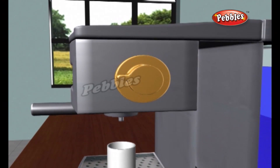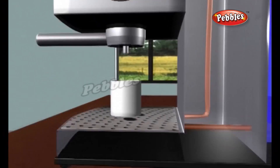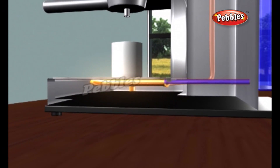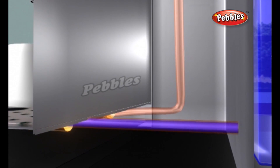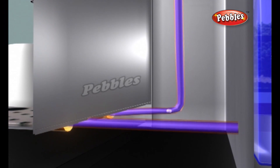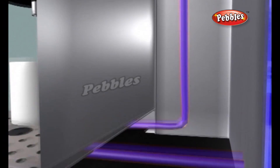When you turn on the switch, the resistive heating element starts heating the aluminium tube and eventually the water in the tube boils. When the water boils, the bubbles rise up in the white tube — exactly what happens in a typical aquarium filter. The tube is small enough and the bubbles are big enough that a column of water can rise upward on top of the bubbles. The water flows up the white tube and is dispersed to drip evenly on the waiting coffee grounds.